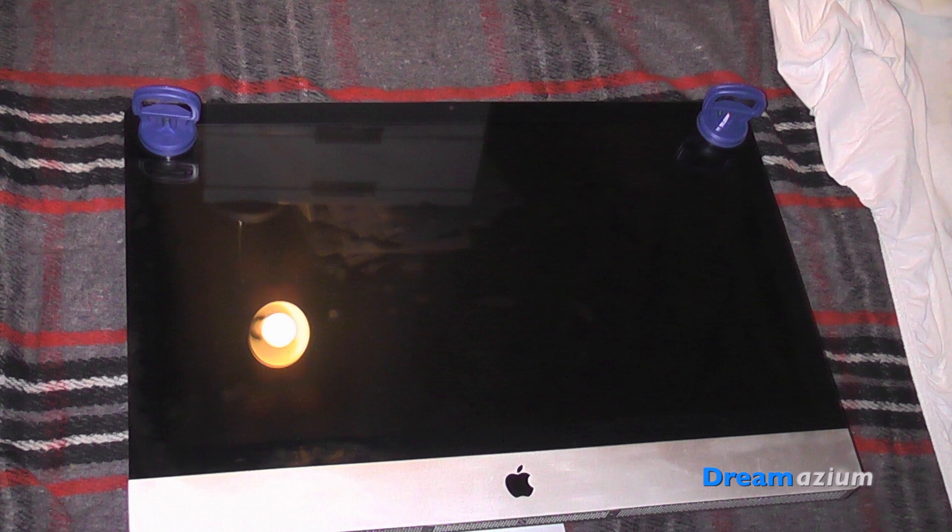On the whole, removing the glass was one of the biggest worries that I had, but it wasn't so bad — it was quite easy in the end with the suction cups. I rested the glass onto a nice soft place with a pillow underneath it. Getting out the actual screen was very fiddly indeed. I found that the screws kept flying off towards the magnets, and once I got the screws out, actually trying to lift the screen was really quite difficult. Some of the cables were easy to disconnect and others were quite difficult — I even managed to cut myself trying to remove the cables. But they were easy to put back in. I think there's a bit of a knack to it and because I don't do this all the time I haven't acquired that knack.